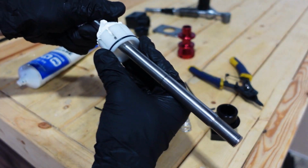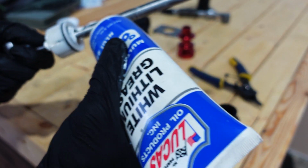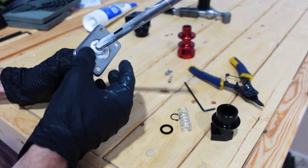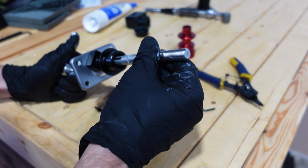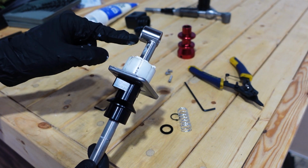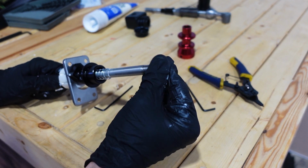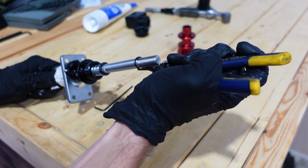Then we're going to take our plastic ring and slide that over and clip it on. And just put it on the shaft of the shifter here. Just kind of spread that around. We can take this metal plate and sit it back down. We'll take our reverse lockout bottom section and slide that down. Make sure that the extrusion here that's coming out is pointing towards the same direction as the extrusion on this bottom piece of the shifter. Go ahead and slide your spring back down on, slide your washer back down on, and then last but not least, we'll put the snap ring back on.